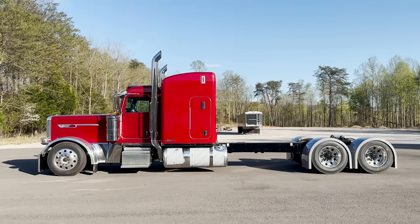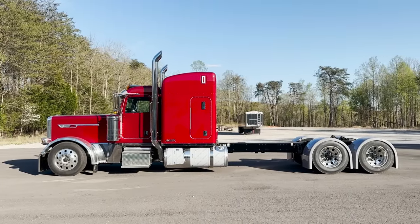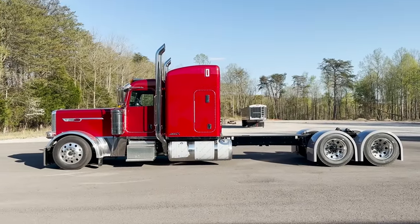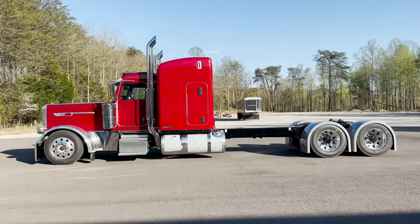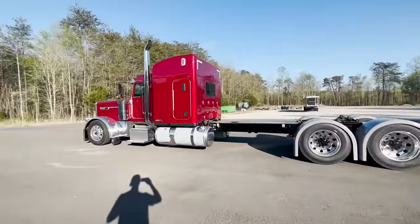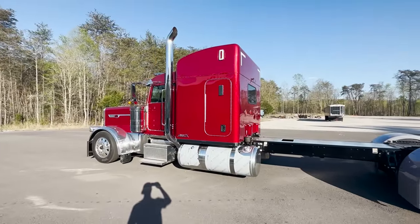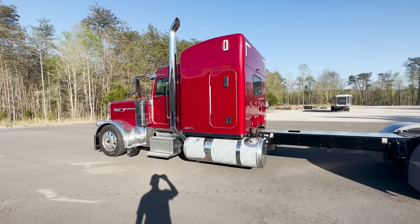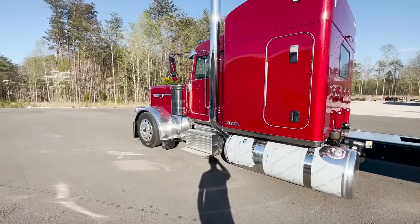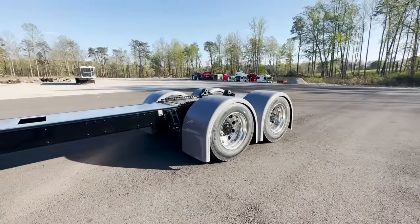We had 320 on Troy's truck and this one's 330. Mitchell said he wasn't being outdone by Troy — he wanted it longer. It looks really cool in the red in the sun; legendary red is an awesome color. Anyway, this is a 320-inch wheelbase — actually 330 — with a five-and-a-half-inch drop axle, factory air ride, and low air leaf in the rear, just to give the truck a good stance.